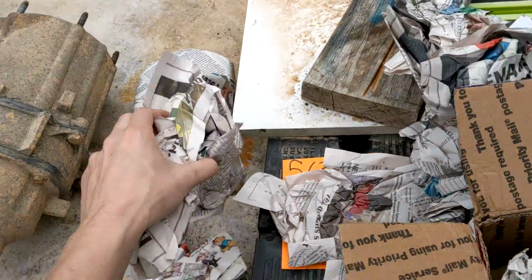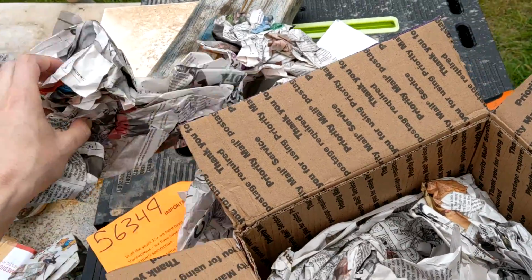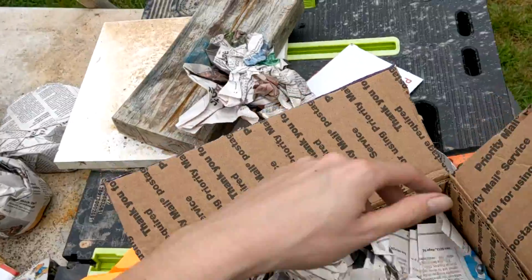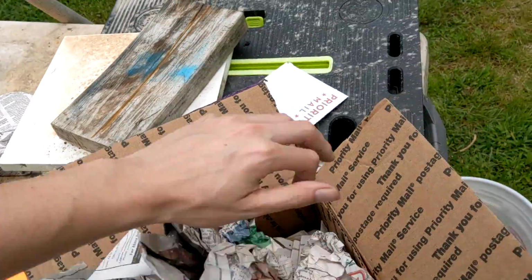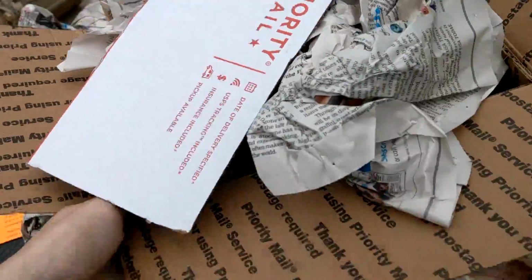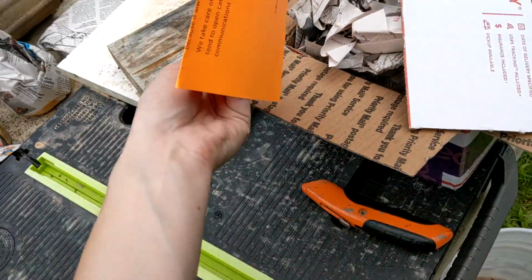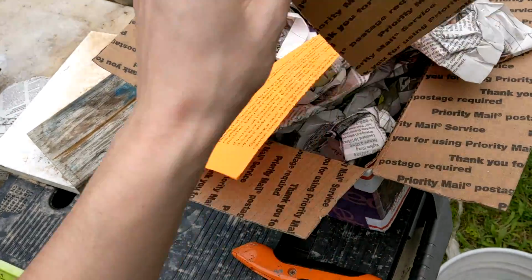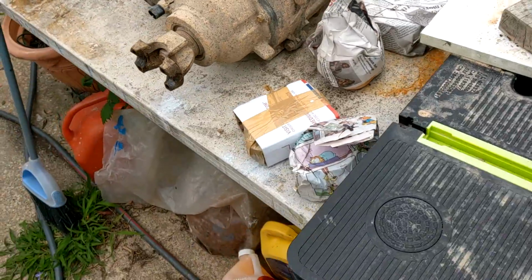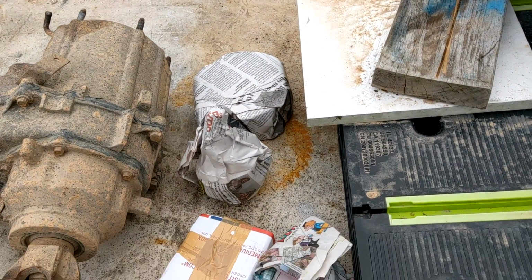There were some Chevy NP231C cases that had a 4-pinion design. That was on Chevys. The Jeep only has 3. And then some heavy-duty Dodge ones had 6. Now, I don't know exactly how you find them, you know, exactly what models to look for, what has what and what doesn't. But yeah, you either pay a lot of money or you try hunting lots of junkyards, and the thing that sucks is if you want to get to that guy, you have to pull a case, I think.